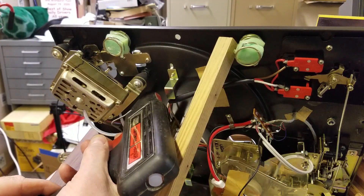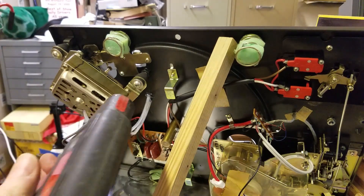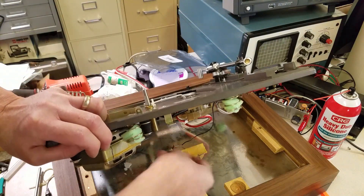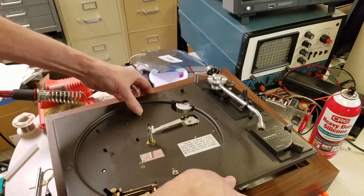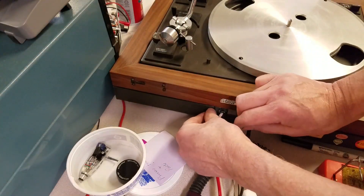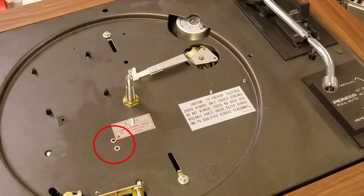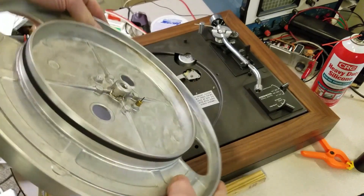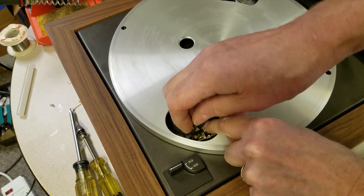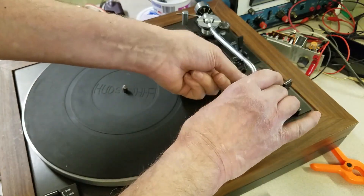I used a little hot glue to hold the oil tubes to the base plate. The tubes were a little stiff and the inside diameter was just a little bit big. After the glue set, I placed the turntable back on the base. There's foam stuffed inside the springs that dampens the movement — this is important to stop the needle skipping. I had replaced the foam several years ago and made sure it was still in good condition. I had to stretch a couple of springs to level up the turntable. I reinstalled the power and output plate, then added a few drops of oil to each oil tube. I put the belt on the platter drum and then slid the platter onto the spindle. With a pick, I placed the belt through the speed change guide and then around the motor capstan. After I replaced the platter mat and stylus head, I was ready to try it out.